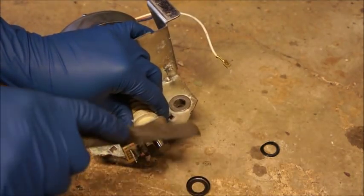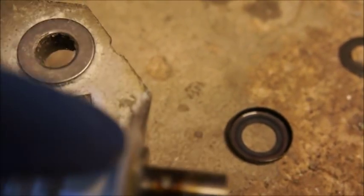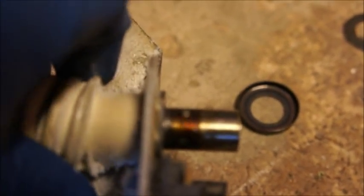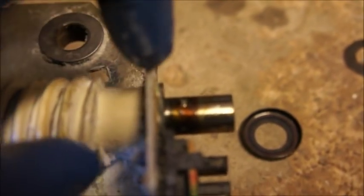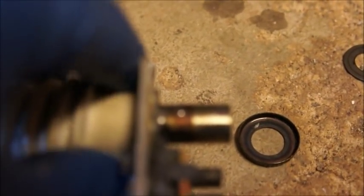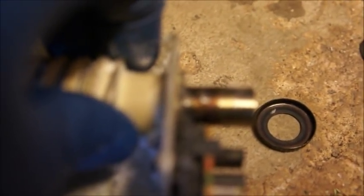I always recommend you take your file and just file down the burrs on the motor shaft. That little silver raised portion on the motor shaft — that's a burr left by the screw. There are pieces of metal actually sticking up that are larger than the bearing. I always recommend filing it down first so you don't forget to do that later. Because if you go ahead and hammer your new bushing or bearing in, it's going to make two large gouges in the new bearing, which puts premature wear in there. Just take your file, file it down, make it nice and smooth so it all comes apart easy and goes back together in good shape.